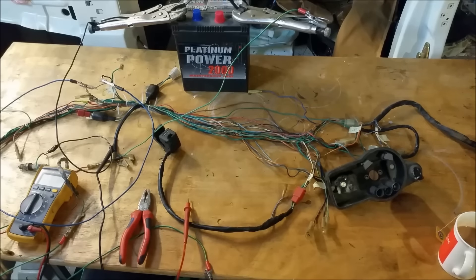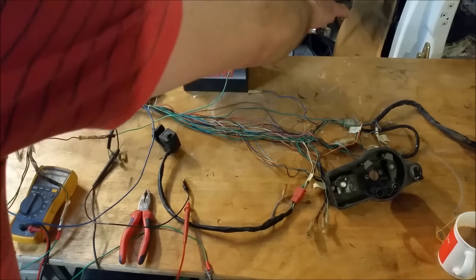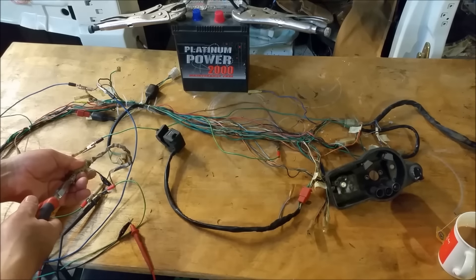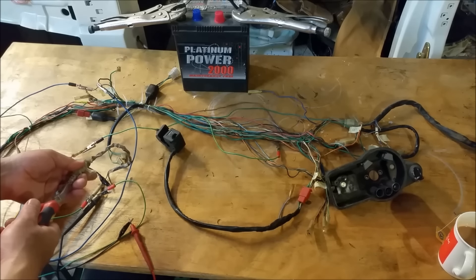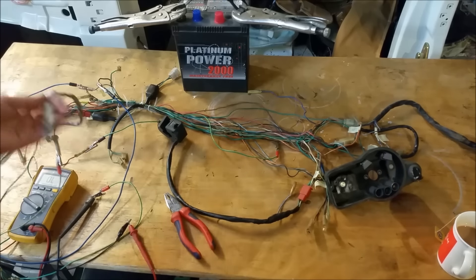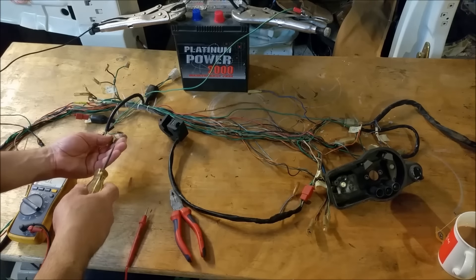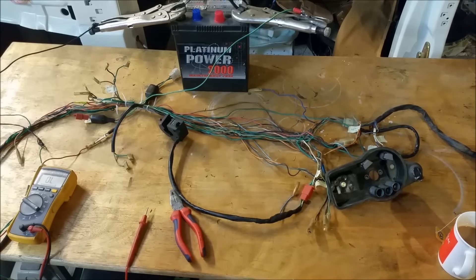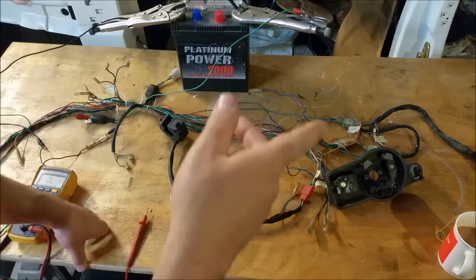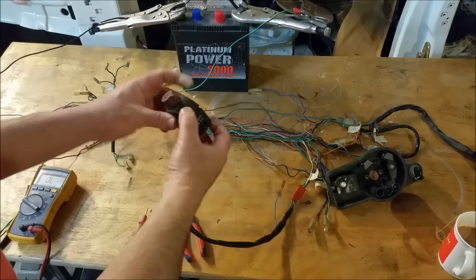It's just a matter of going through checking circuits like that. All this looks pretty good. The thing I'm a little bit dubious about is the brake switch. Oh, it works! I tested it before and it didn't. I was going to say it's probably better to get a new brake light switch for the back. The front one should be a bit better. Horn — again — there we go, we've got a horn. So it's all looking really good. It doesn't check those things under load, but it does check that they're working. Before we put the switches together, a couple of shots of contact spray in there — make sure they're all good — and we can put them back together.